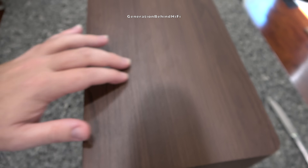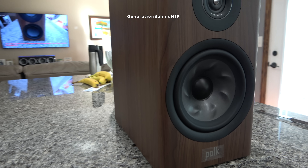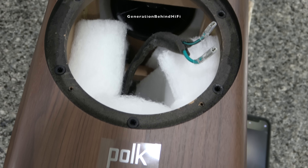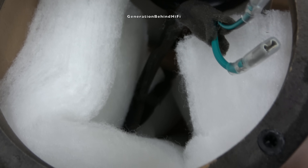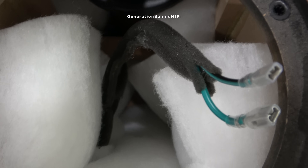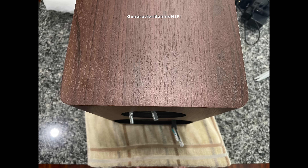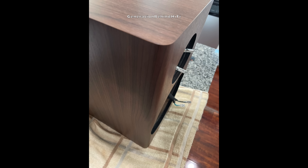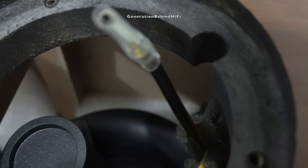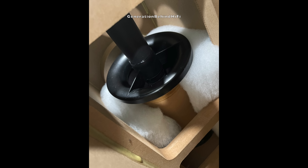The Polk Reserve R200 and Monitor Audio Bronze 100 offer some of the best fit and finish I have seen among speakers priced under $1,000 per pair. The vinyl wood grain finish is among the nicest I have seen, and the cabinet's construction quality is well above average for this $800 price point. The enclosure contains ample high-quality damping material, and a center brace connects all the side walls together, enhancing structural integrity and reducing cabinet resonances. The front baffle measures seven-eighths of an inch thick, and the side and rear walls are three-quarters of an inch thick. Polk also rounded the front baffle edges, reducing sound wave diffraction and baffle step for a smoother, more predictable frequency response. They even repurposed the leftover piece from cutting the woofer hole, gluing it on top of the enclosure wall for additional strength.